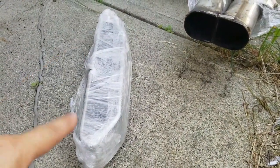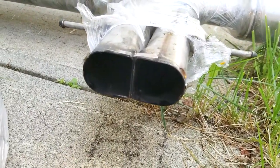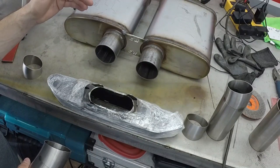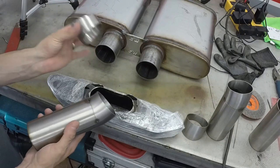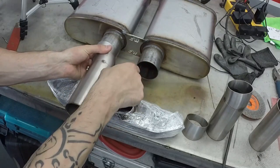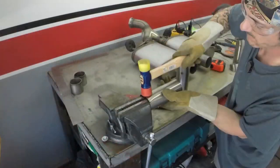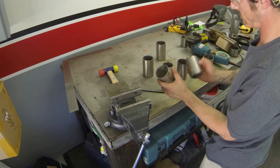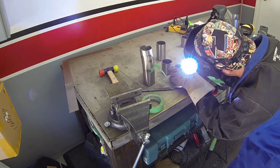Here's my fun idea for the exhaust. I've gone ahead and removed the factory tip from the factory exhaust tubing. If you take a look, that's actually two tubes that have been flattened on one side to fit together in order to fit that oval. The spacing of the muffler outlets are way farther apart than they need to be. To solve that problem, I bought some 2.5-inch stainless tubing and made some pie cuts from a 90-degree elbow. The game plan is to jog the two outlets towards each other, add a stub to get the proper length of offset, then jog the lines back with another angle which brings the new outlets close enough together to fit the OEM tip. Before I can get the correct measurement for the offset, I need to do some work on the tube ends to add that flat side. Once the tubes fit snugly, everything gets taped together to keep the alignment and all the pieces get tacked. I'll be doing a future video on some TIG welding basics, so be sure to subscribe so you don't miss it.